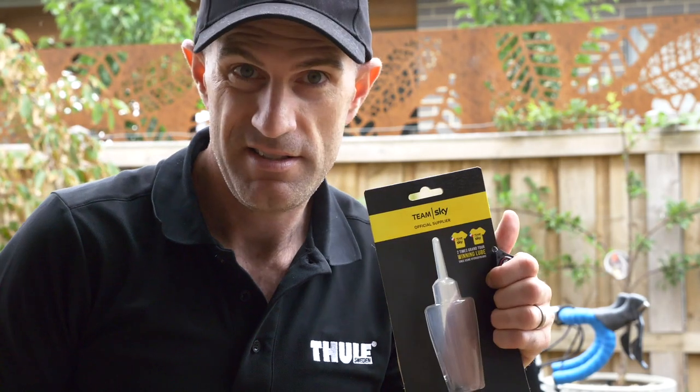I just put the chain on and go and just use the packing grease. I'm doing something different today. I'm going to strip the grease off this with the ultrasonic cleaner and I'm going to try this Team Sky Muckoff Hydrodynamic Chain Lube, which comes with its own CSI crime scene ultra something or other. It's some sort of high quality lube that I'm going to try in place of the packing grease that I'm usually a fan of.